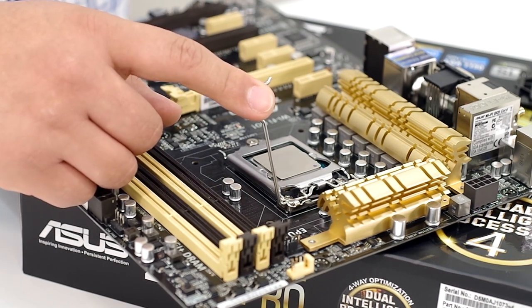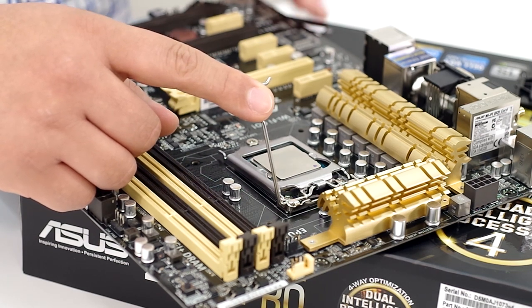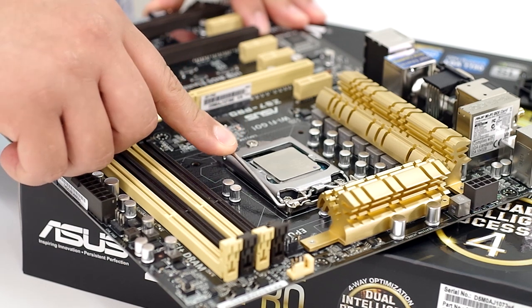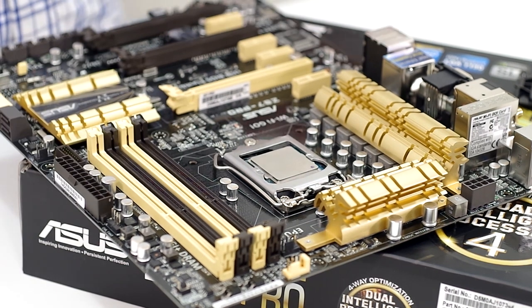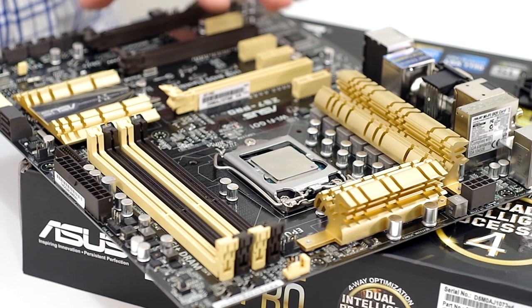The resistance is from the retention plate making contact with the IHS and then making contact with the actual pad underneath it. We're going to keep coming down, keep feeling resistance — that's entirely okay. You're going to want to swoop out and then go ahead and insert in. And now you've gone ahead and successfully installed your CPU.